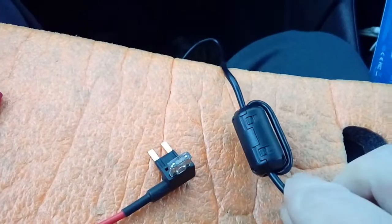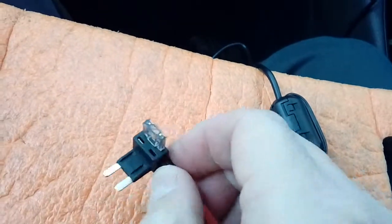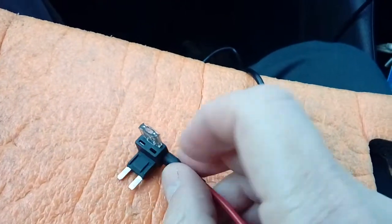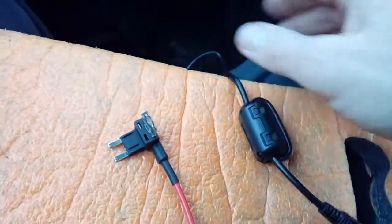The cable goes through, wraps around and comes out — just wrap it around and then snap it shut. There's the item closed, and there's a two amp fuse put in ready for the camera. The other slot will be for the fuse you pull out of the fuse box.